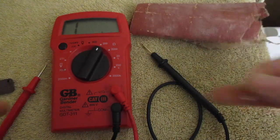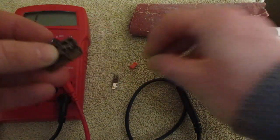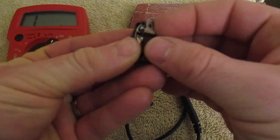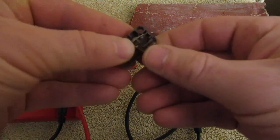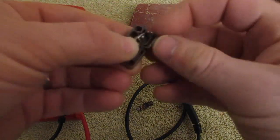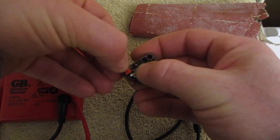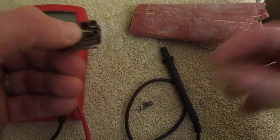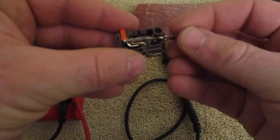Now what I've done is I took that micro switch apart, just used a piece of sandpaper, and I sanded off the burned ends. I pulled this out with the needle nose pliers — as you can see, that's shiny in there now too. I'm going to just pop this and seat this back together. This little clicker tab just sits right in there, and I've got to make sure that these two ends, which you'll see are a little thicker, line up.